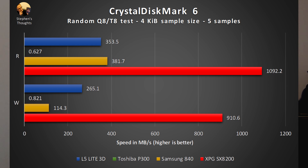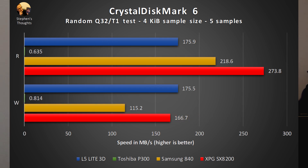The first random test is the most impressive in my opinion. The SX8200 absolutely destroys the P300 by a factor of over 1,500 — it's absolutely insane. The other SSDs are far behind the SX8200, but also far ahead of the hard drive, which just looks pathetic in this case. When you drop the thread count down to just one, even with a queue depth of 32, the margin shrinks quite a bit. The hard drive performs virtually the same as in the last test, illustrating that hard drives are not one bit faster in multi-threaded tasks than in single-threaded tasks — if you give it several things to do at once, it'll still just do them one at a time.